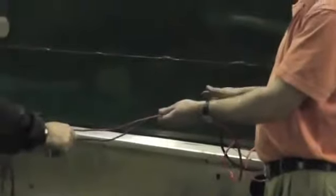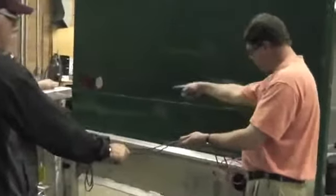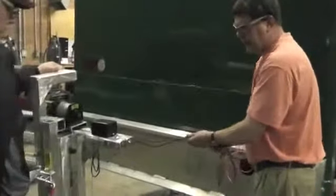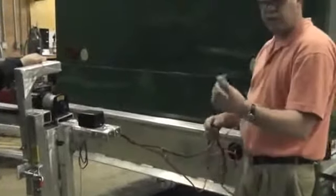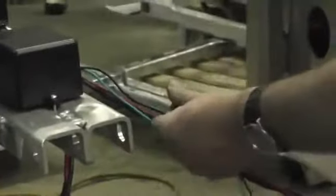Connect your wiring up at your chassis battery. Don't connect the ground wire as of yet. Bring your wiring back through the chassis, bring it up through the bumper because it'll all be connected right here. Then take your switch wires — black to black, green to green, and red to red.